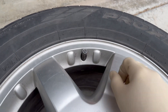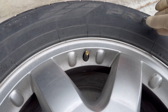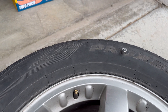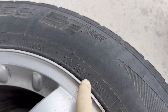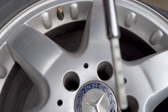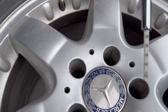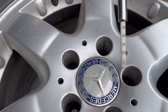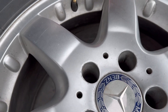Here is a typical air filling valve. The tire size on this car is 275/55 R17. We're targeting 32 psi. The tire is currently slightly below 32 psi, so it looks like we're going to have to put some air in these tires as well.